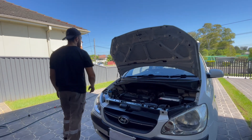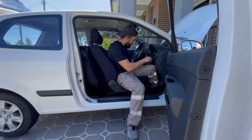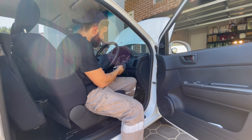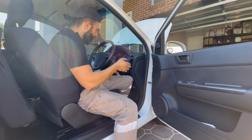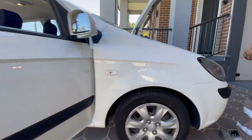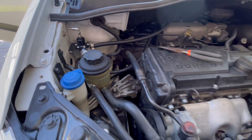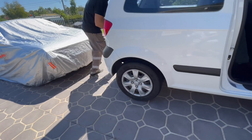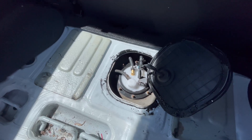Fuel probably took a while to get to the front. Let's run it to the engine and check for leaks. Fuel pressure is a bit under where it should be — that may explain the hard start. If you follow me around: checking the tank — tank seems fine, that's good. Now I'll dial it in.